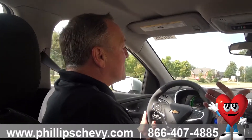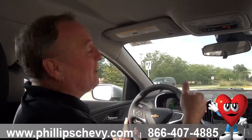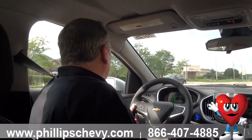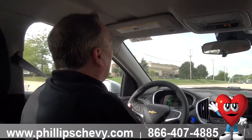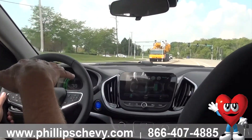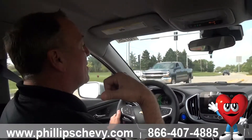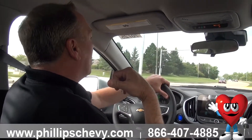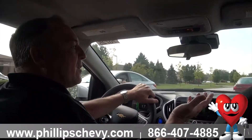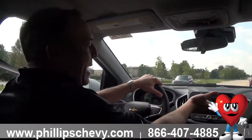It'll actually bring me to a complete stop. I actually drove a Volt the other day — I had 53 miles on the EV range, drove the vehicle like 17 miles, and only used 4 miles of range. Watch as I go to the stoplight here. I'm going to lift right now and try to time it. Even though my car is slowing down without me touching the brake, the vehicle is bringing itself to a stop, and my brake lights are on so the people behind me know I'm slowing down at a more than normal rate. If I lift, it brakes and the brake lights come on, and every time I do this it's throwing energy back into the batteries.